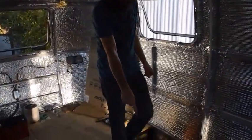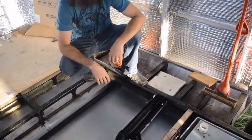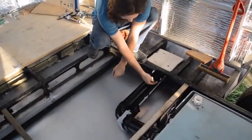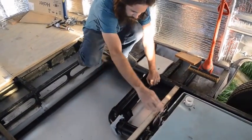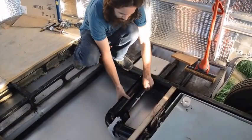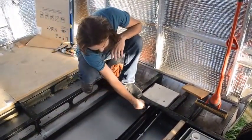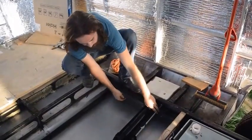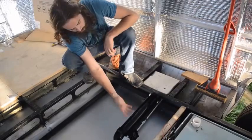Today I got the grey water tank hooked up with new piping because the old one I missed too many parts, so I had to just rebuild it. This goes outside through a new hole which you pull to open the valve so the grey water tank can drain out through wherever you're going to drain it. I still have a bit of taping to do and then I'm going to close off this hole when the pipe slides through, and close off the old holes which were for the rods from the black water tank and the grey water tank. They didn't line up so I just made a new one.